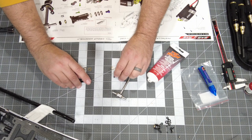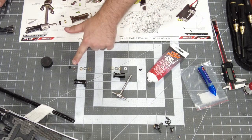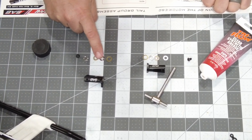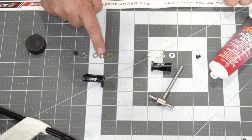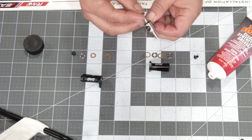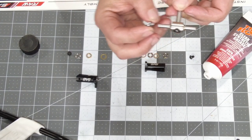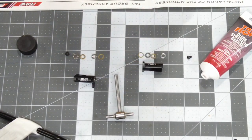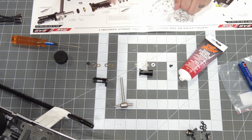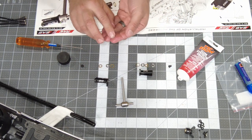So we've got our spacers on the outside of our dampeners on each side. The next step is our blade grips. We'll go ahead and pack them full of our thrust washers and spacer. These thrust washers come in two versions: one with a larger inside diameter and one with a much narrower inside diameter. You figure out which is which by sliding it over the tail shaft — if it wiggles back and forth, that's the larger inside diameter, and it goes toward the center of the hub inside your blade grip. I'll use a hex driver to stack these up in order.